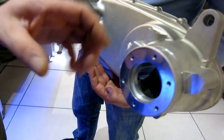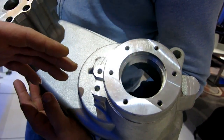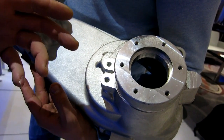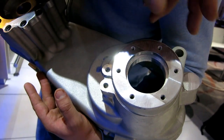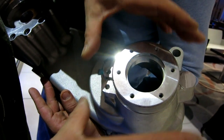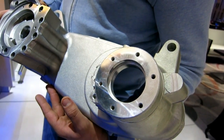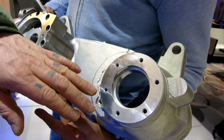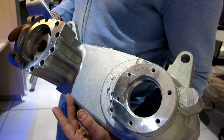On the back, this has been machined to take an option of two brake units. One is a simple dustproof dust cover with a back plate and two brake shoes — with the stand machined down through here, using the same operating cam, but the brake shoes are both open externally as per motorbikes, not just from one pivot point. Alternatively, you can have a back plate with a hydraulic rear disc, using this for the caliper fixing on both sides. So basically you have a choice of brakes.